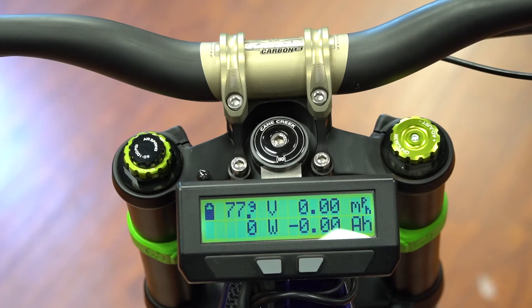Realistically, we set it a little higher, so it starts reducing power before that — probably around 62 or 63 volts. This is a quick-glance gauge. The very top left of your Cycle Analyst has a battery gauge so you can quickly see how much remaining life you have.